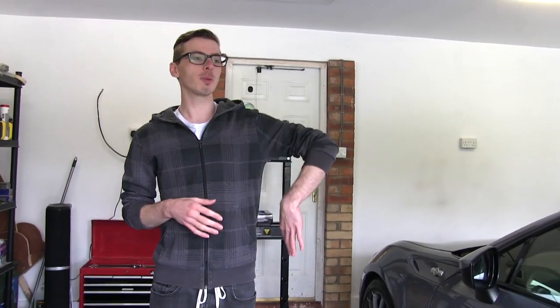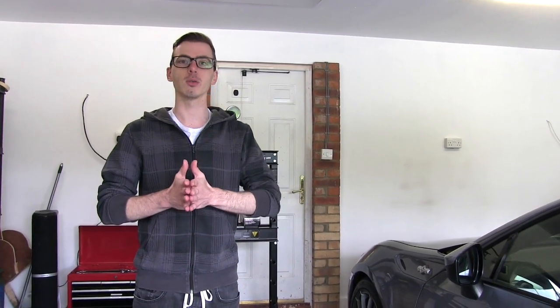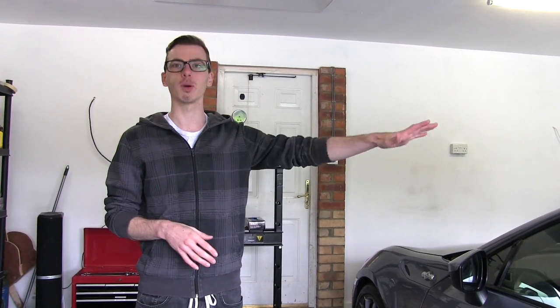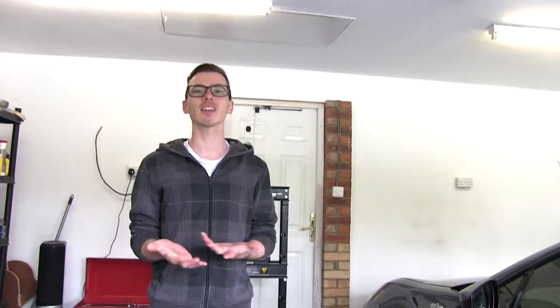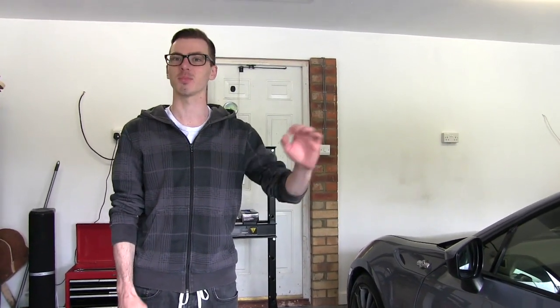Basically, once it's been painted, it'll go a bit dull, and there might be some high spots, some low spots. So what they try and do is they go with a really aggressive pad, really aggressive polish, just bang, whip over the car. Sand the thing. Yeah, and it's designed to just get it looking half decent like this. Yep. And they can't really justify spending extra time refining it and machining it to perfection like a detailer would.